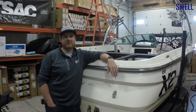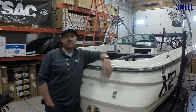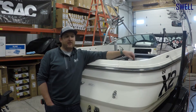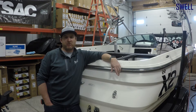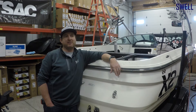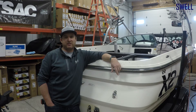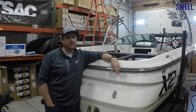Welcome to episode 4 of the 2006 Mastercraft X2 build. In this episode we are going to install the pumps and the custom fat sack bags that we have made. The rear locker bags we designed to tuck underneath the rear seat a little bit — those are 880 pounds each. The front plug and play bag is 300 pounds, and we're filling that through the KGB tank, which we left in the center of the boat. Really the only way to get that out is to split the hull, which is too much of a project to tackle on this one.